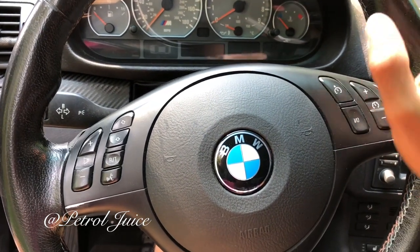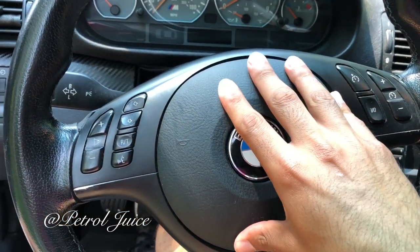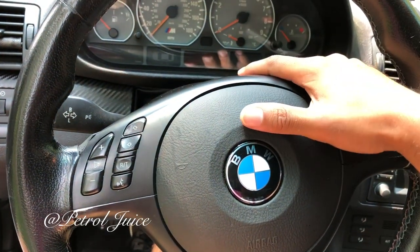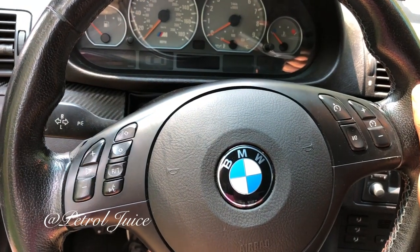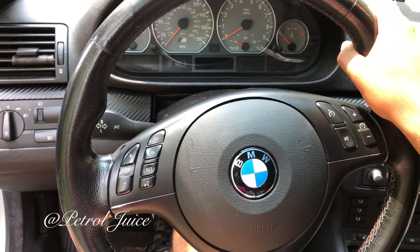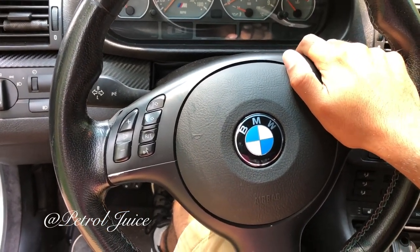As I researched, I found out that the real problem is: as I turn the steering wheel, it sounds like there's a screw that connects the airbag and presses down to the actual wheel, making a connection that makes the horn go off. Whenever I turn the steering wheel it sounds like something is loose and rattling around. So we're gonna open it up, double check that's the issue, tighten it up, and confirm that's the fix.